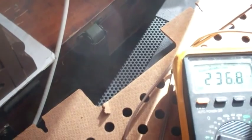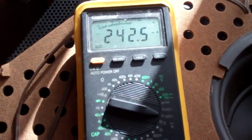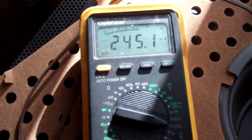It's really hot and humid today. I put my cathode current meter on it — the cathode current should be about 180 to 200 on this, but it just goes right up to 300. So what I did is to eliminate the regulator and the high voltage rectifier as causes.